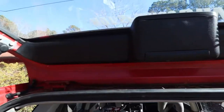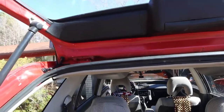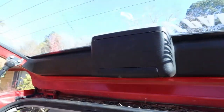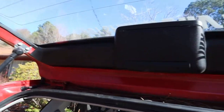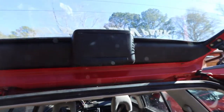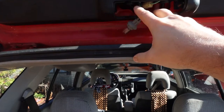Before I get started, I'm going to go ahead and remove this third brake light panel and the plastic here. One weird wagon thing I've noticed is no matter what trim color you have in your wagon, this little black third brake light panel is always black. Never seen a black interior wagon. It's pitch black — not dark gray, black. I'm going to pop this off, get the bolts out of here, and use that existing wiring for the brake light — that'll be the shortest route.